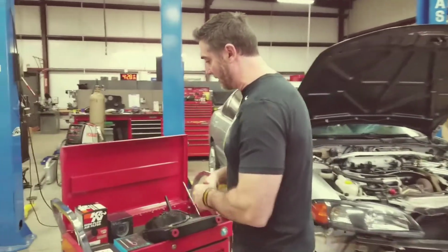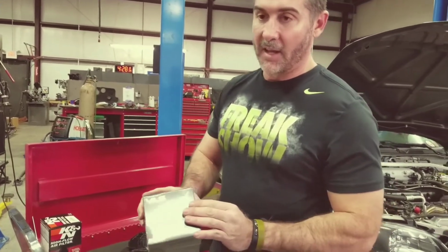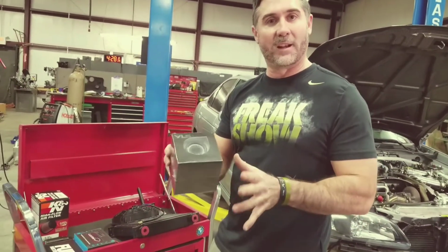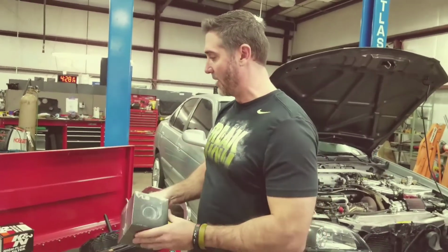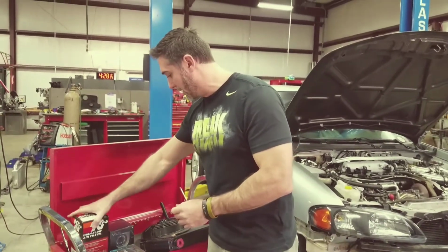Next, obviously in the kit is the boost gauge, right? Wherever you want to put it in the car, that's fine. You're going to see typically the wastegate set for about 7-8 pounds, so you'll see it start at about 7 pounds, and right towards the end, it'll probably get up to about 9-ish, just because it's ball bearing and the thing spins so fast with that manifold. Your K&N filter, right? It's in the kit, pretty simple.